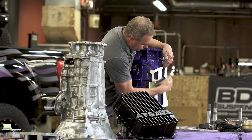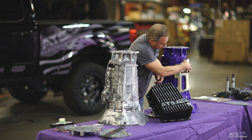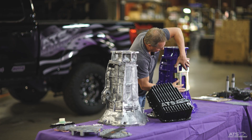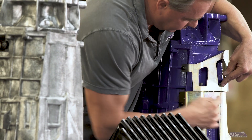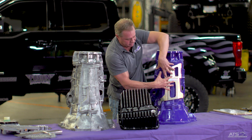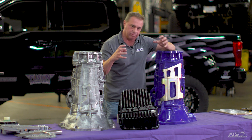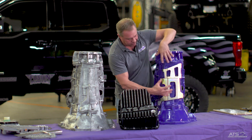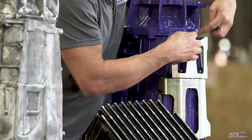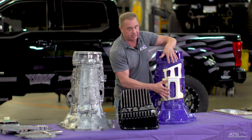Add the brace you see here. It actually grabs the top of the transmission before the crack area. You have bolts down here, then the second member comes up on top of the transmission. You tighten this portion down, this portion down - and I intentionally left this portion not tightened yet so you can see how much room there is between the front member and the rear member. As you tighten it down, it pulls that together and pre-stresses the entire top of the case - just like pre-stressed concrete where steel bars compress and release. It completely compresses the top of the case, so your stress member goes from the back of the transmission all the way to the front. This entire member is now de-stressed and pulled together via the transmission brace, completely eliminating case breakage.